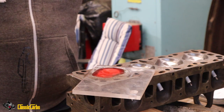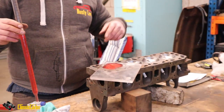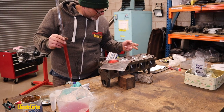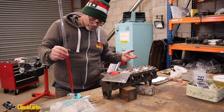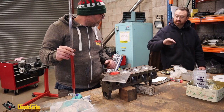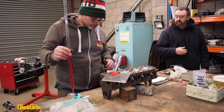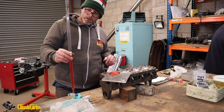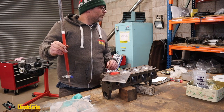Dude, do you want to have a visual look at the combustion chamber of that head there? And just see if it looks tremendously different, because, okay, we've got the valves. These are different valves, but that's it. Why would the CC be so much bigger? Well, maybe because the valves are scooped? Very likely. I think that could be it, dude, because the other ones weren't. Can you bring that head up, please? So we've got zero. Are there any valves in there? No.